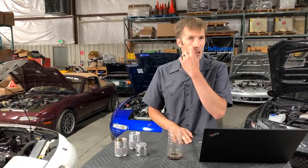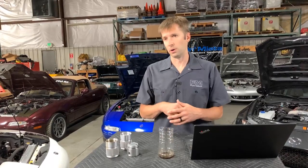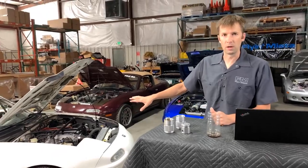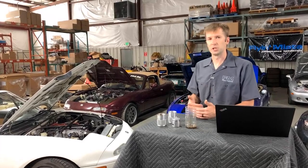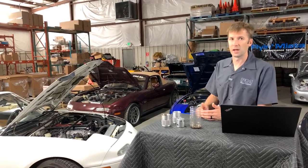Question: does a stock ND1 need or benefit from one if it's already got 100,000 miles on it? Sure — it's always beneficial. It's still going to get worse without one. This car had at least 100,000 miles when I put the catch can on and it's still beneficial — still pulling all this junk out of there, and that's junk that's not going into the oil supply, even ignoring the intake valves.